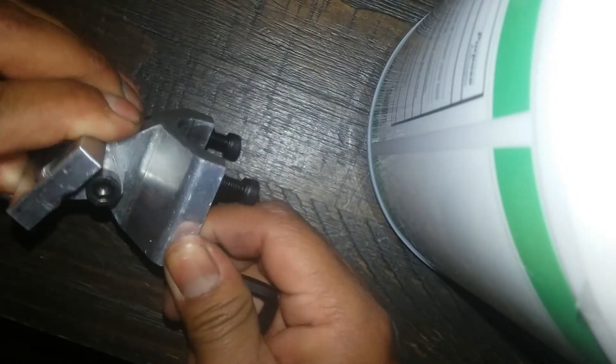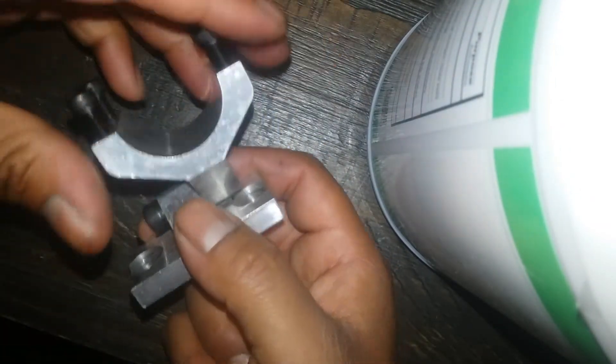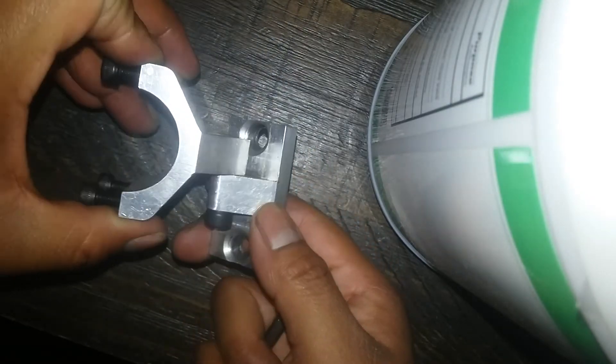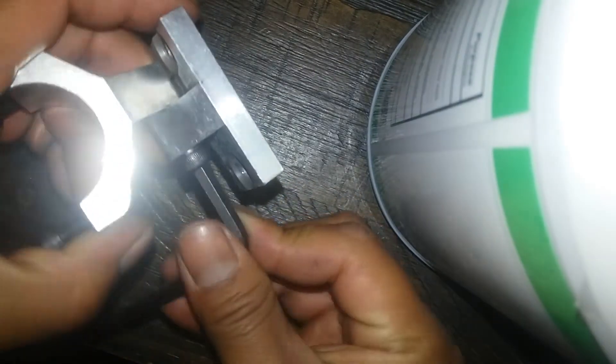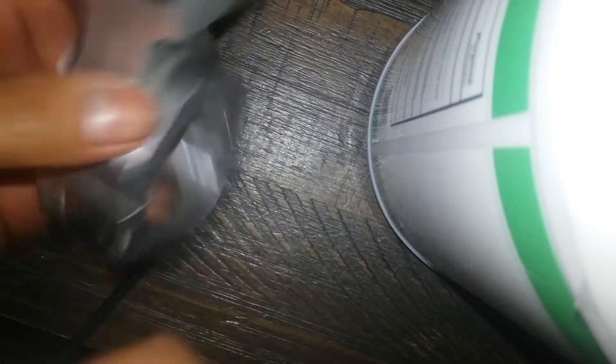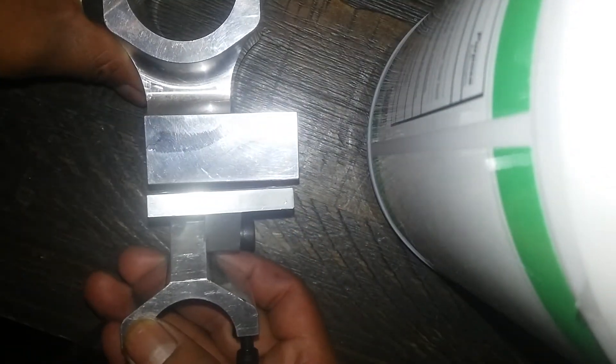You screw in your threads and tie it up as tight as you want, so you can have a rear engine mount and it's adjustable — that's pretty good. You bolt that, I have the bracket that goes here — I just don't have it here — but it's bolted like this. This is the setup. You find the location, torque it down, and it really doesn't go anywhere, especially when you have a solid front mount like this. That's going to throw your motor this way and that's going to throw your motor this way.